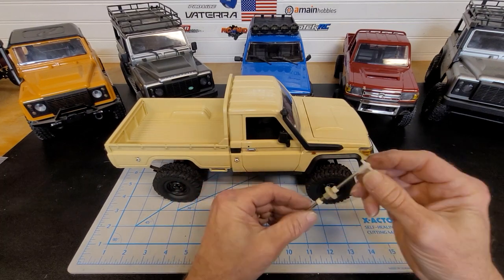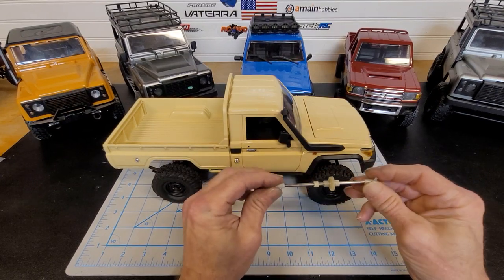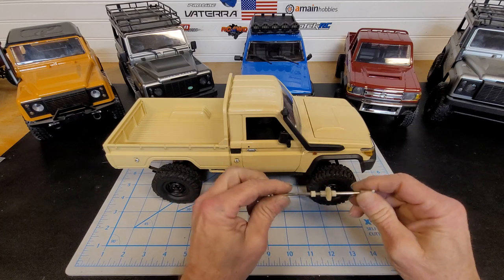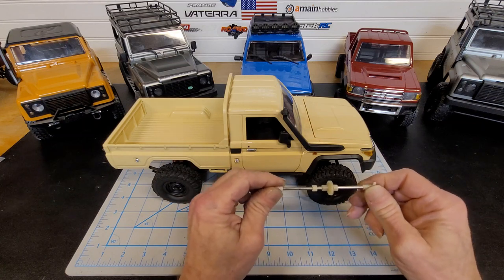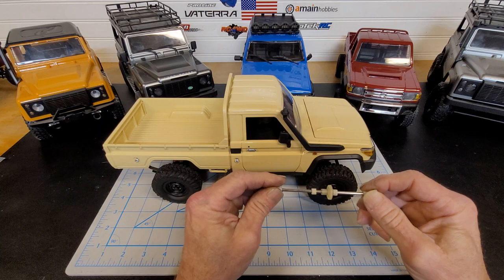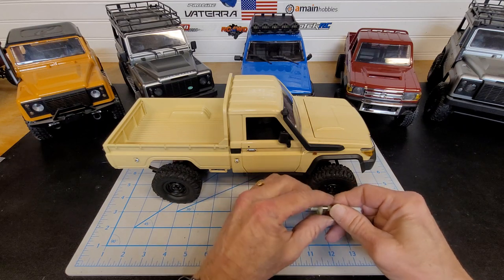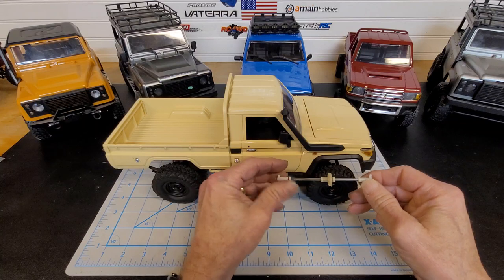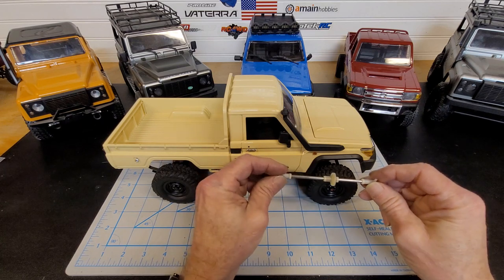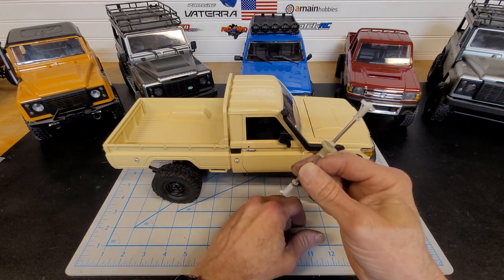I pushed the brass sleeve down as far as I could get it on both sides, then reinstalled both dog bones back on, keyed where they should be. They are super, super tight now. The cracked one — you can't move it, it's really tight now. Is this as good as a metal axle from WPL where everything bolts together with Loctite? Probably not, but it's way far better than it was.